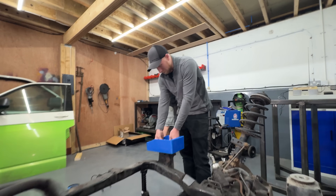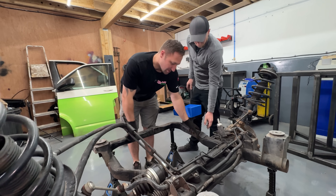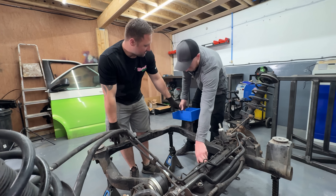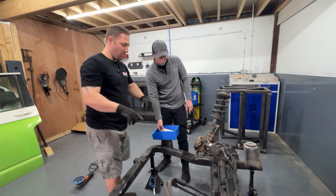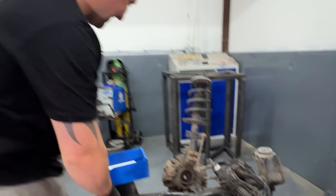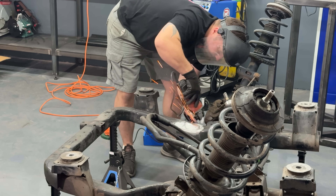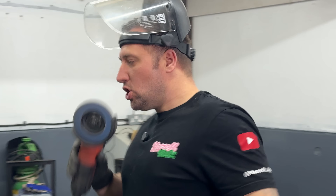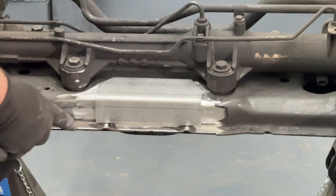So what are you going to do now Nick? I'm going to clean up the areas around where these need to be welded. I'll clean up all these areas and then I think we're going to bolt the lobes to the motor, offer the motor up, and then we'll weld it all in place with the motor in the position we want. Right, I'll leave you to it. By eye? No Nick, not by eye - that has not done us any favours as we're going to find out later in this episode. He cleans up the surface with a flappy paddle to get rid of all the old paint, ready to start welding those brackets on.